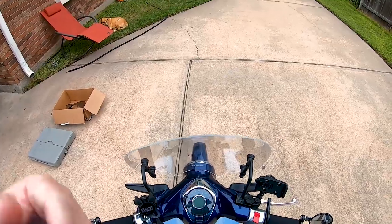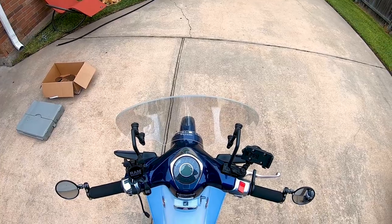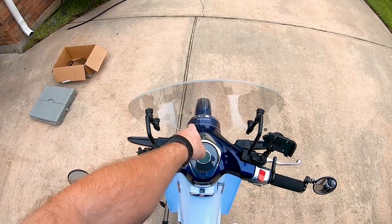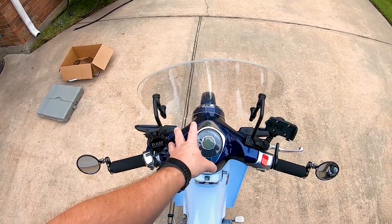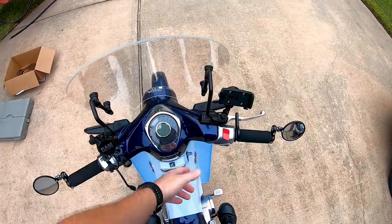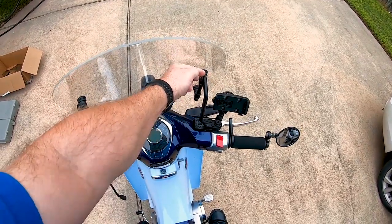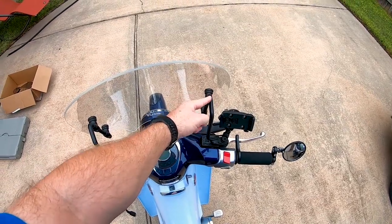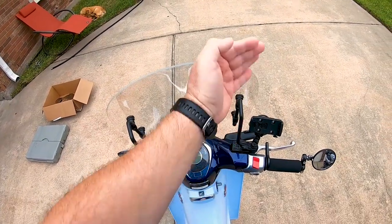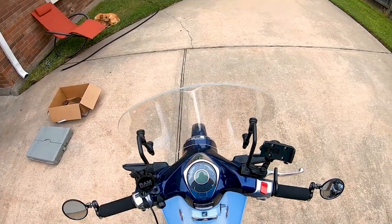Get up where my eyeballs are. You can see how crooked that screen is — it's pushed out about an inch or more on the right side, yet the bottom is crooked down here. That's the best I could get it because this bracket is just too far out. The bend on this weld or the bracket itself is just off. I tried bending it in at the bottom, but that didn't really help because the length portion is too long up here and that's what's causing the offset. No matter how I tweaked and twisted the mounts, I could never get this side even with the left and still maintain alignment at the bottom.